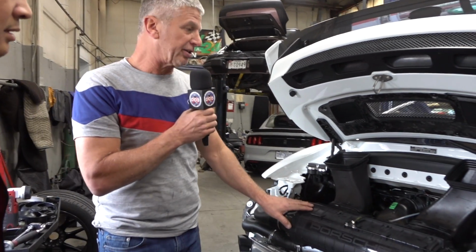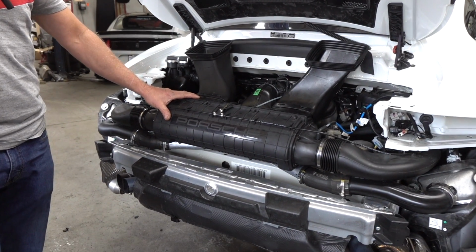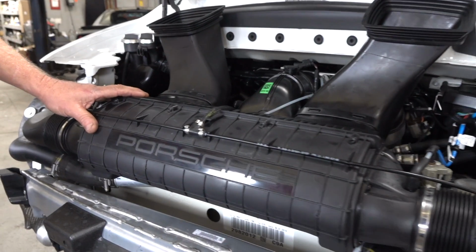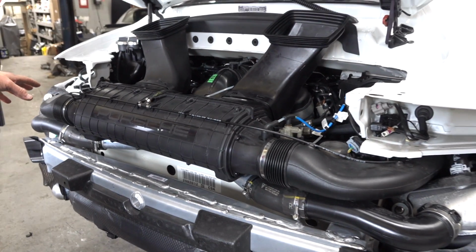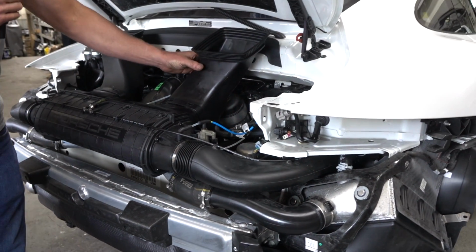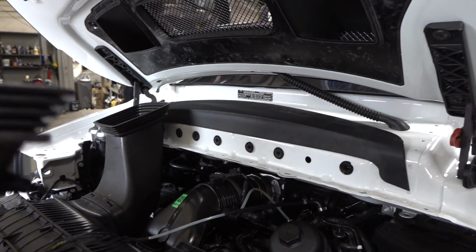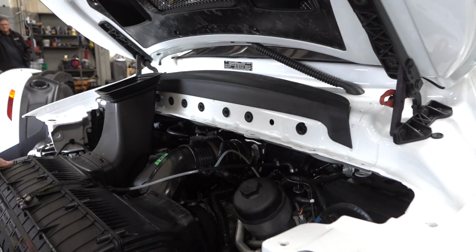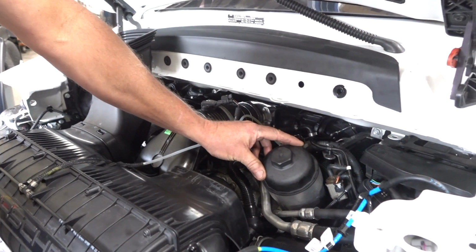Vu, while we have the car down like this, I'll just point out a couple of small things. In order to service this car, which right now has 1,600 miles, and it was about 1,500 miles on the Nordschleife and 2 days at Spa, we're servicing all the fluids, and in order to change the oil filter, you literally have to remove the bumper cover. You have to remove the airbox assembly, and that's to gain access to the oil filter assembly.